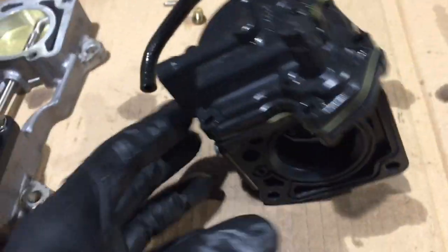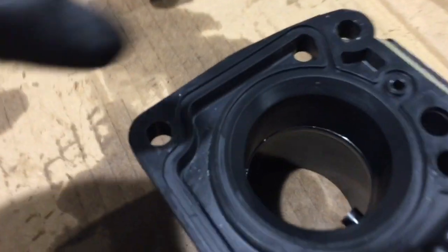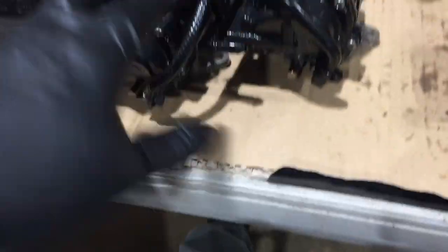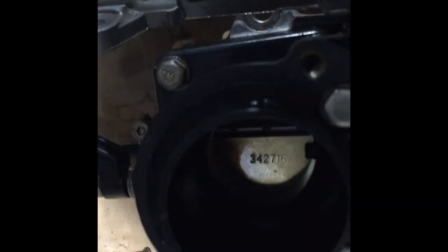Before you bolt this back on to the throttle plate, wipe it down and make sure it's all clean. Make sure to get the appropriate seal — my kit came with two seals and this carburetor only has one — so take that one and put it on there the right way, get it in all the grooves, and put your body back on. Do that three more times and your carburetor set will be done.